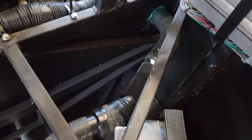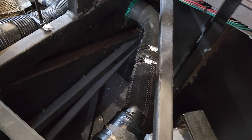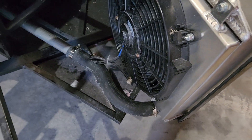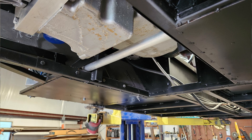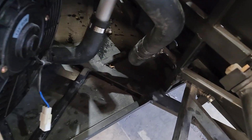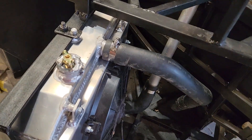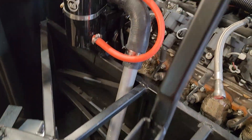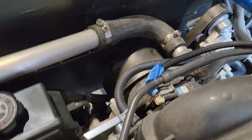Here we come from the water pump out to the firewall. Here's a reducer from an inch and a half to an inch and a quarter. It goes into the top of this radiator, then out to the bottom of that radiator through a tube. It comes out there and feeds the top of this radiator. It goes out there, out the bottom of this radiator, back into a fill cap, and then goes back into the return.